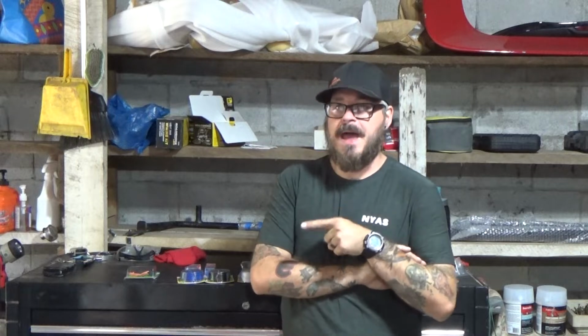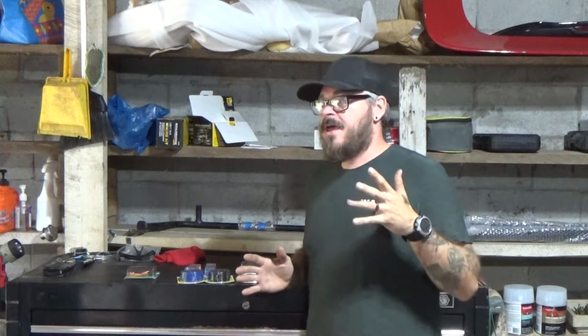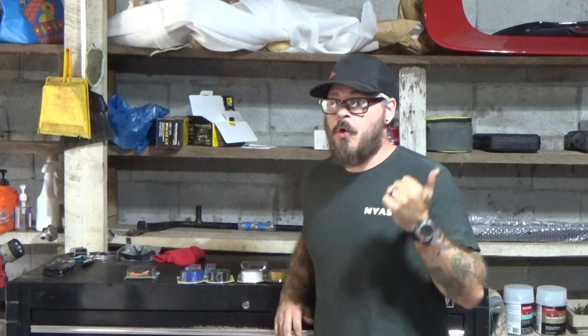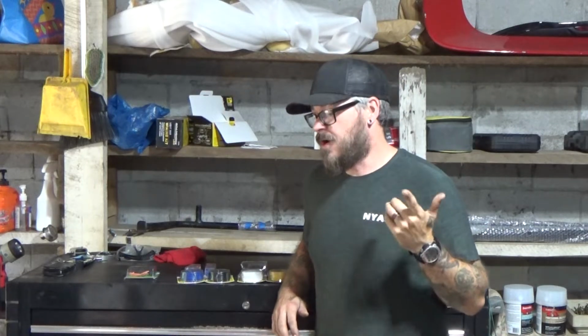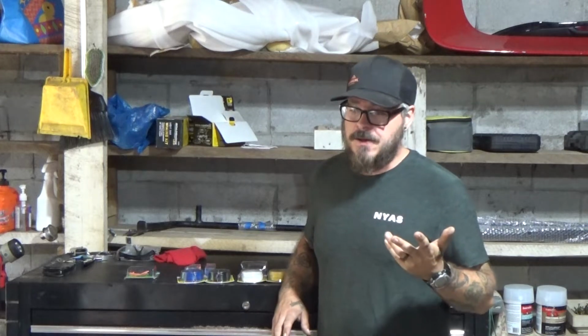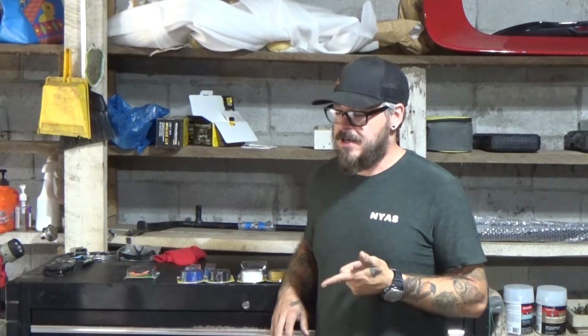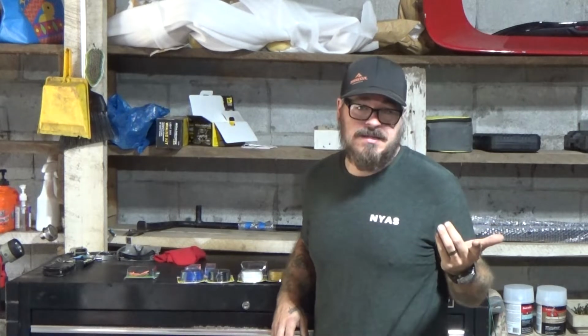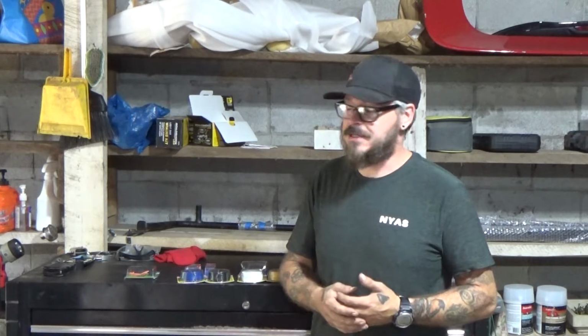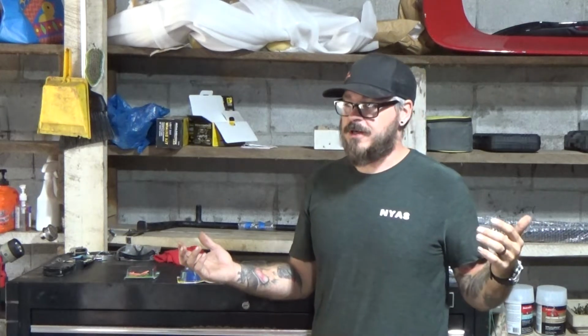So I'm going to be jumping back into the switch panel. I've got a couple of other things ordered and a couple other things here that I want to get through. I do have ordered a horn and turn signal kit. I do also have already installed another headlight system, but this does have taillights in it. But I did have to hack into the taillights to get them to work as running lights and taillights. I'll briefly show you that and show you what I have to do to extend the wiring harnesses and get it to work. But that's what I'm going to be jumping into today. More wiring, more sorting, more making it right.